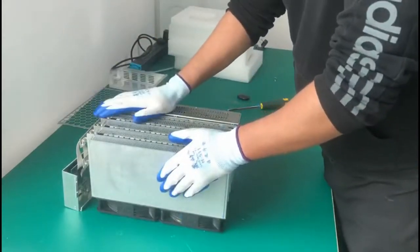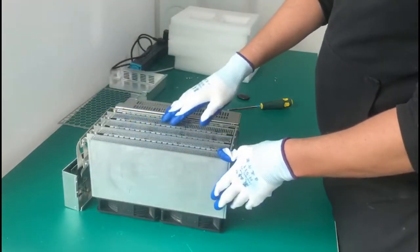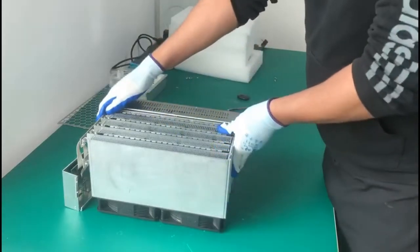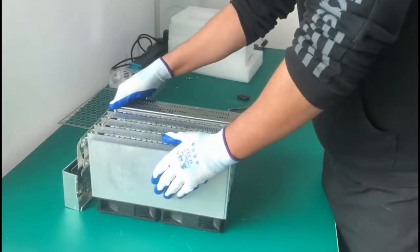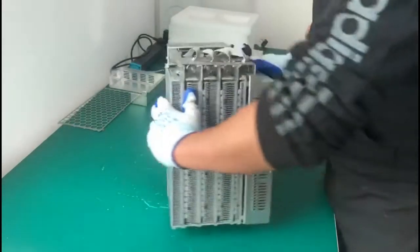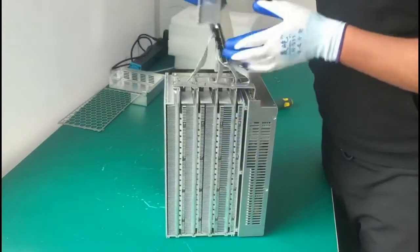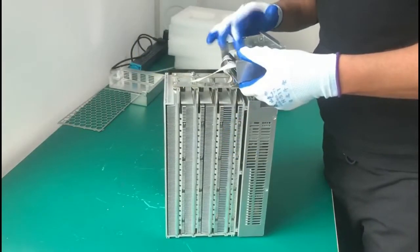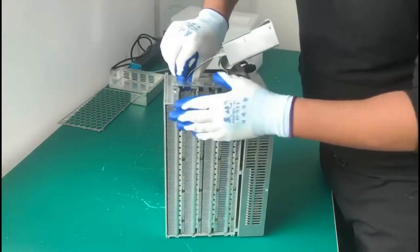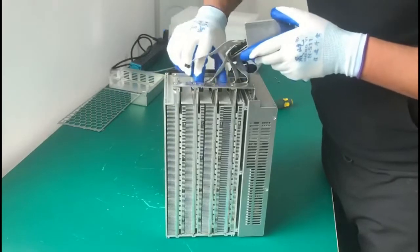Okay, so here we have it. I already took off the front grill, so now we have access to the hashboards. But before we pull the hashboards out, what we need to do is disconnect the data cables that are connected to this control board. So I'll go ahead and do that. I'll just disconnect the first one. Okay. This one is done,